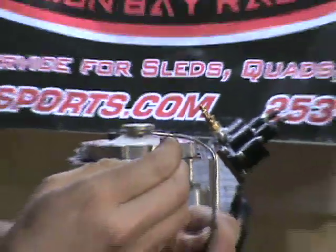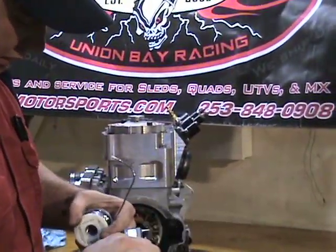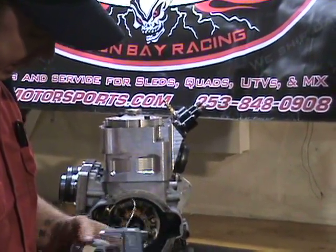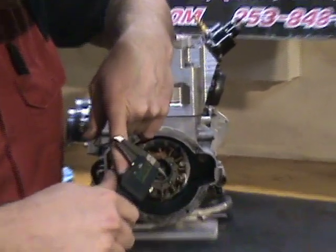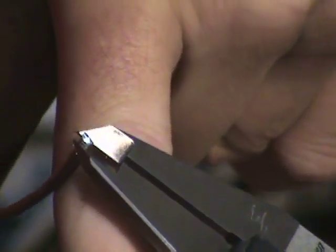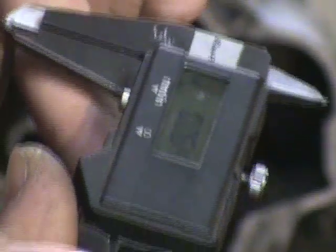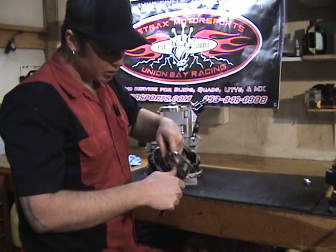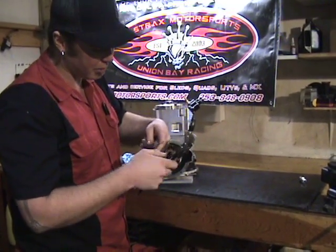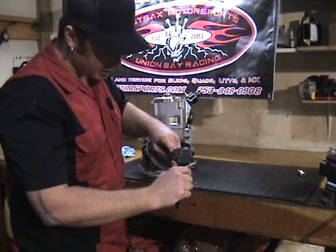You can see now that the piston has smashed the solder very thin. We're going to take our calipers, make sure there's no dirt in there, make sure they're zeroed out, and measure that reading right out at the very tip. This one is set at about 64 thousandths. If you're working on a watercraft or a Ski-Doo, you can't measure all the way out at the tip because it's actually thicker there — you'll have to come back from the tip just a little bit. We're still reading 65 thousandths.